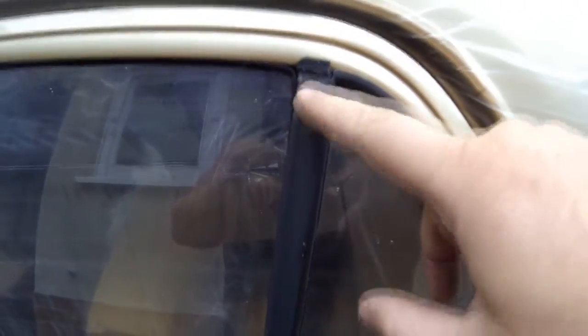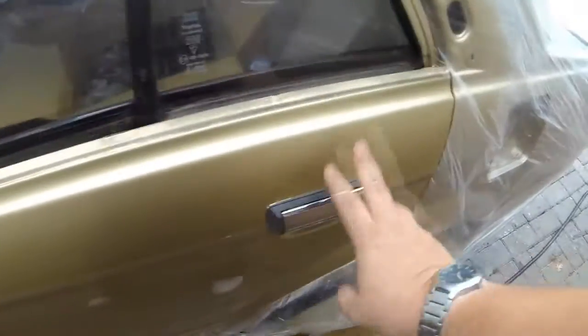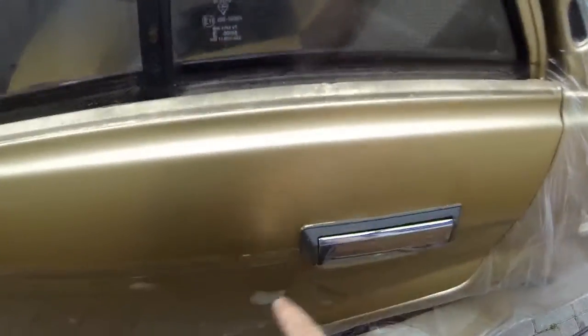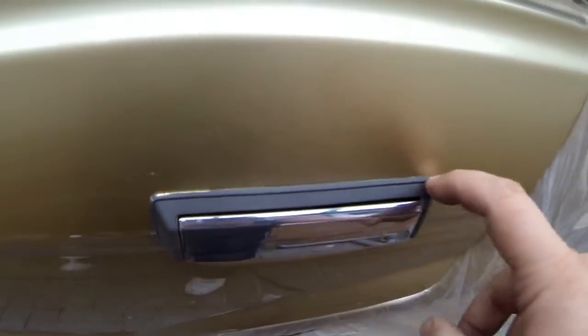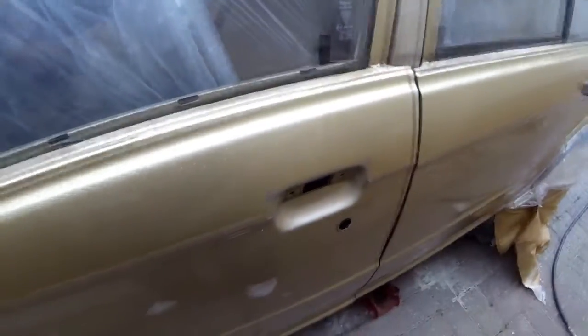There's a little bit of work on the black stuff here — this is just a slight rub down. Treat this surface rust with a rust inhibitor, and then they'll be painted satin black or something like that. Don't forget, all the trim's got to go around the doors. I've started taking the handles and the locks off. Whoever's painted it before has still got the gold paint around where they've not masked up properly. So that is one of the things — if you take the door locks off, you're going to get a more professional job, and at the end of the day, that's what it's all about.